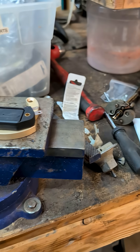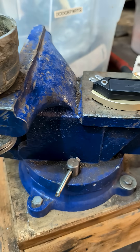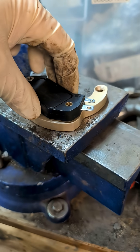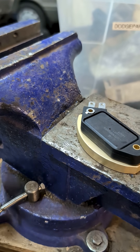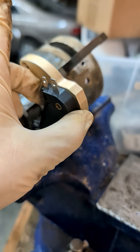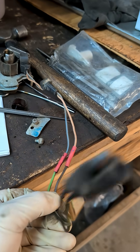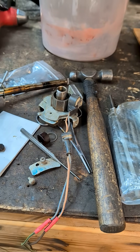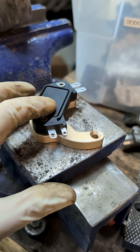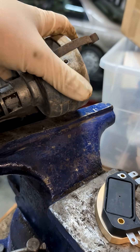This really isn't going to be a tutorial, but I wanted to show this HEI ignition module conversion on the old Dodge distributors. Somebody came up with this cool little bracket that actually bolts onto the bottom of the distributor housing, so you can use an HEI module instead of the old Chrysler pickup and transistor box. We're just going to use the pickup here that connects directly to this HEI module, which will heat sink onto this plate and then onto the distributor housing.